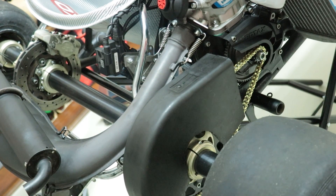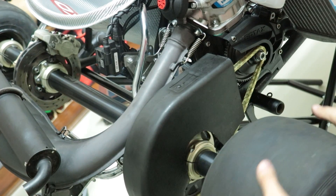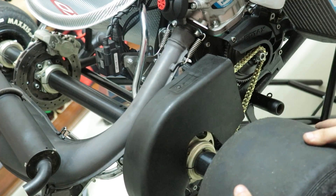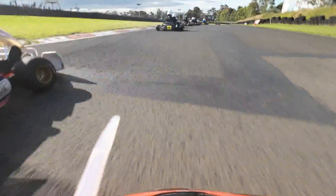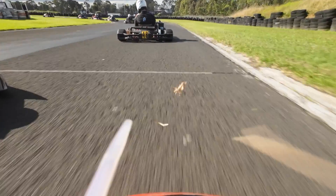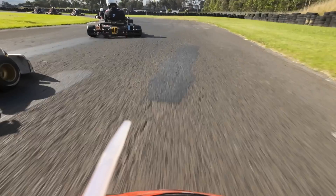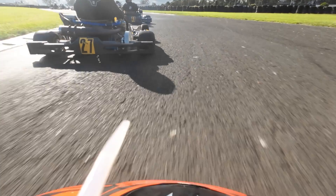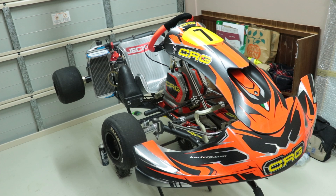If you're traveling in a straight line, having no rear differential probably doesn't matter, but once you get to a corner that's where problems start. When you go around a corner, the outside wheels trace a larger radius than the inside wheels and naturally want to travel at different speeds — but they can't because of the solid rear axle. Go-karts get around this because there is some flex in the chassis which acts as crude suspension. You can see here how the kart at the very front flexes to the point where the back left wheel is actually off the ground as it goes around the corner, effectively making up for the lack of a rear differential.